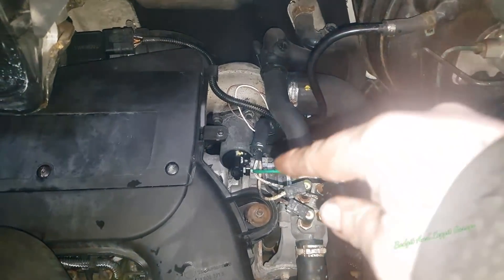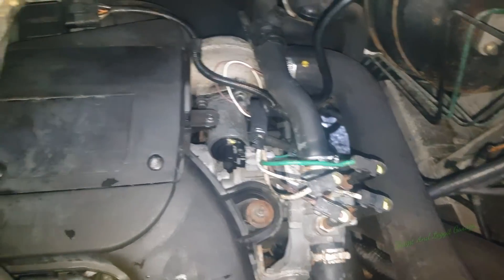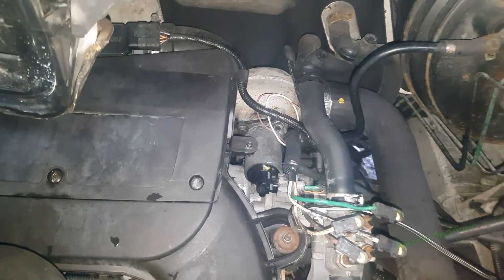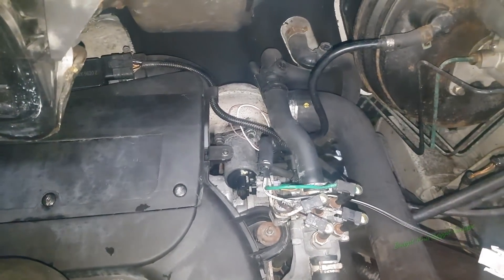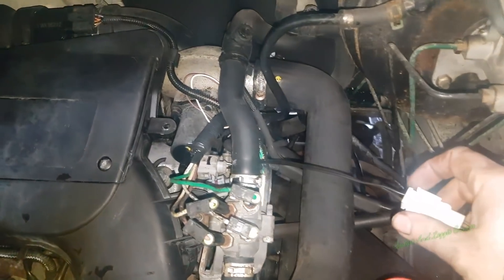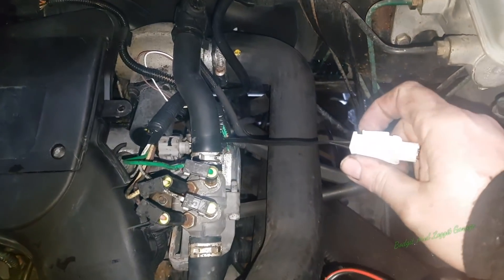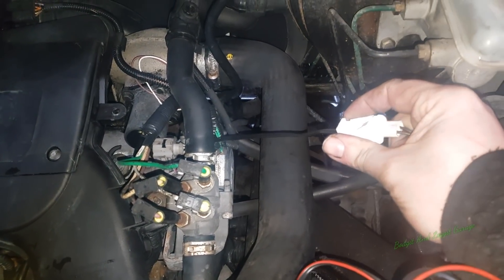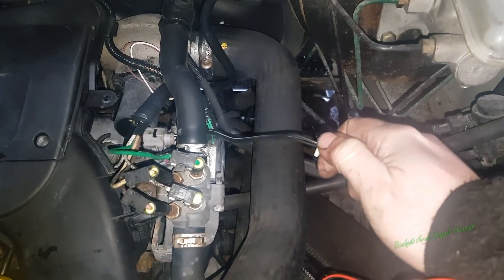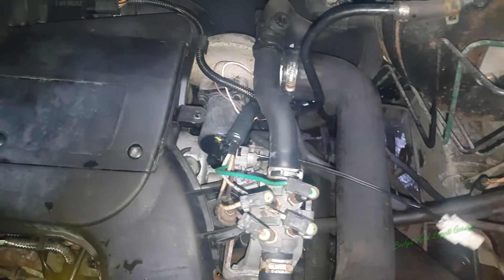It's just quick and easy to do, especially with this EGR valve. The connection is right there — it just plugs straight in and I know in seconds. We are plugged in and the EGR valve isn't shorted internally, because if it was, the machine would beep at you. It isn't.